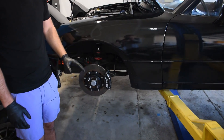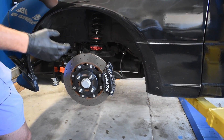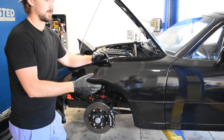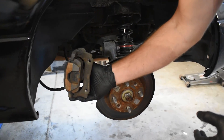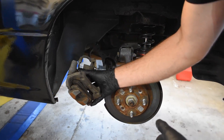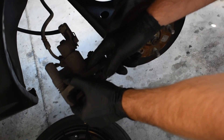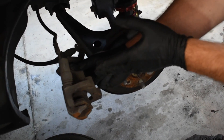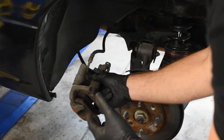This is an upgraded big brake kit — this brake caliper is a little bit different than you'd see on a typical car. This is a four-piston performance caliper. So I pulled the rear wheel and rear caliper off to show you what a normal brake caliper looks like. This is a standard one-piston brake caliper. When you push the brakes, brake fluid comes through the brake line and causes the piston to protrude outwards, and as that piston extends, the brake pad comes forward and makes contact with the brake rotor.